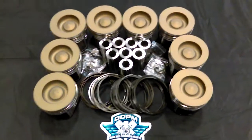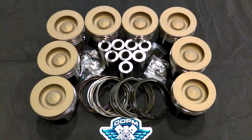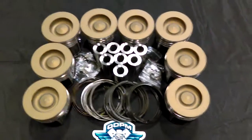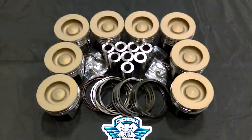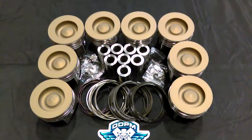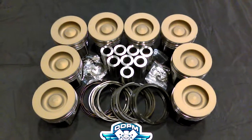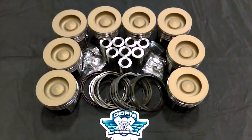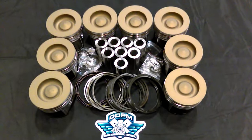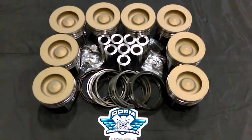With that said, obviously it's going to make more horsepower. If you can add more fuel and more air into the cylinders, it's going to make more power. These pistons have been rated up to the 1,400 horsepower range pretty well. We've had a lot of guys out there making above 1,200, 1,300 with these pistons all day long and not having any issues.